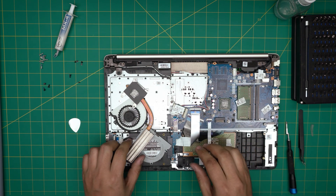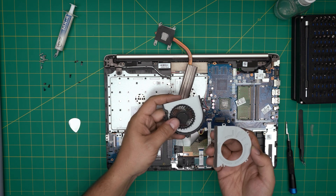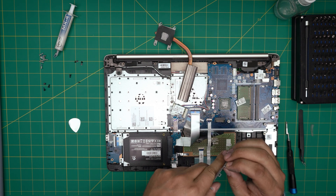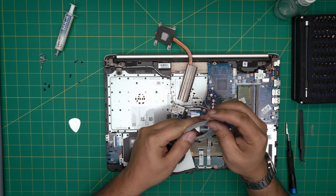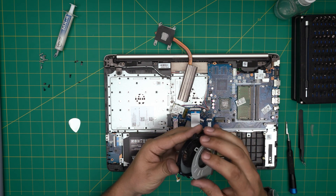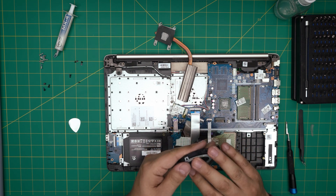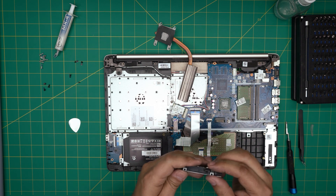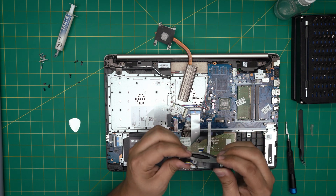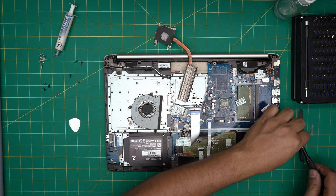The fan condenser and fan are now cleaned. Before putting it back together, slightly bend the clips back inward — about one millimeter — so they grip the hooks properly. Put it through the hooks, align it, and push it down until you hear tiny clicks. Make sure it hooks through properly, then put the single small screw back on the plate.